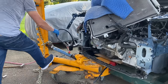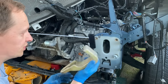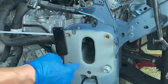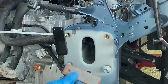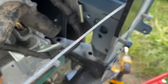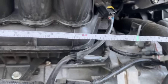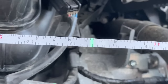Now I can roll in the pulling tower, get it attached by pounding in the wedge to lock it in place, then rotate it into position for the frame rail pull. I'm going to use this seal hook, just snaking it right in there. But I don't want to bend the lip on the mating surface, so I'm slipping in a quarter-inch thickness piece of metal in there — as I make the pull I'll be pushing right on this steel plate, which will push the entire side of this frame rail. Right now we are at 445 millimeters and we need to be at 437.5, so basically we're going to make a 7 to 8 millimeter pull.